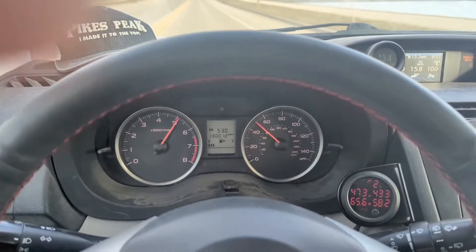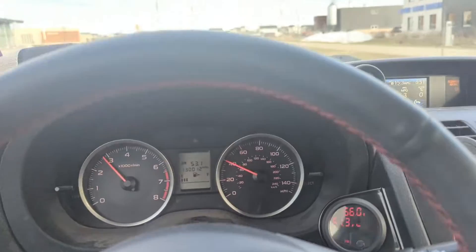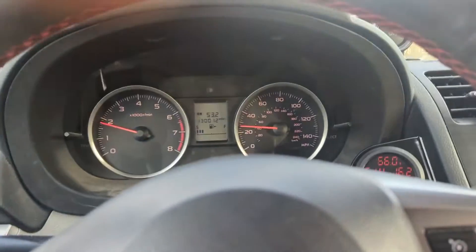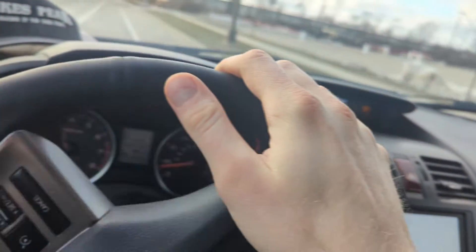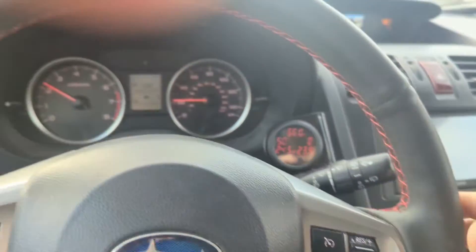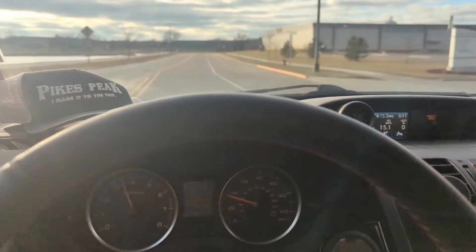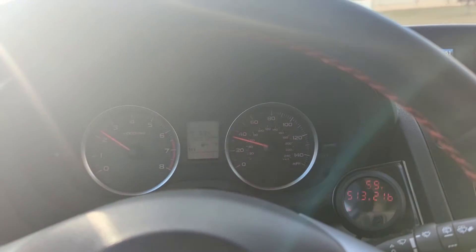It actually feels a lot faster. So that might answer my question about whether I should have a bypass valve or not — the times will speak for themselves. Let's turn around and do one or two supercharged tests. Right now because the bypass is open, if I turn the supercharger on there's actually very little noise and of course no boost. So if we want to do a proper supercharge test, we've got to close the bypass valve. Hold that for three or four seconds — should be fully closed. And then we can do another zero-to-60 run.